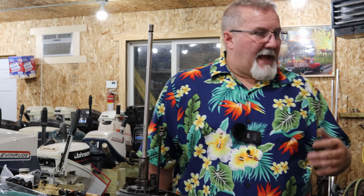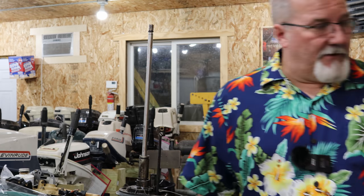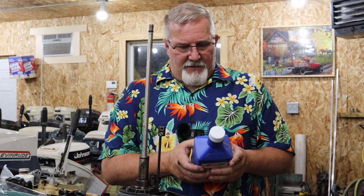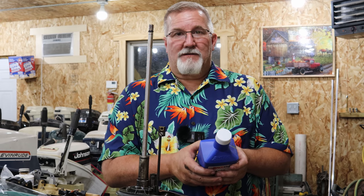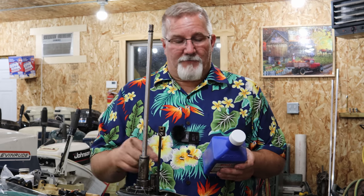But one of the main reasons I do use AMSOIL 75W90, and there again, I'm not sponsored by AMSOIL. I just like to protect my stuff as best as possible because it's not cheap. This oil is not inexpensive at all, but I'll read you exactly what it tells you. Delivers exceptional wear protection, even when contaminated up to 10% water. That's big, especially in something that's used in water.